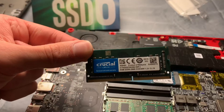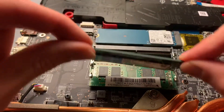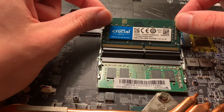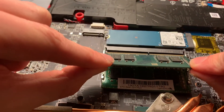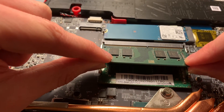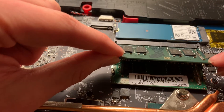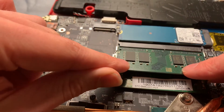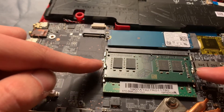I've got the Crucial memory and I'm going to go ahead and put this in. You can see the pins only go one way — they match up like that. It's very important that you put this in correctly the first time. Slide it in at an angle; it's not flat with the laptop yet, but go ahead and lock it in. Then use the corners here to press down — try not to press on the circuitry — and lock this into place until you hear that click and both sides are secure.